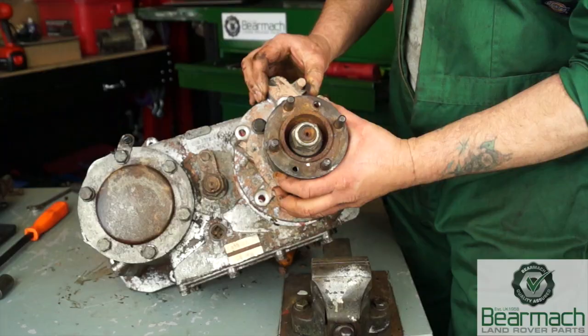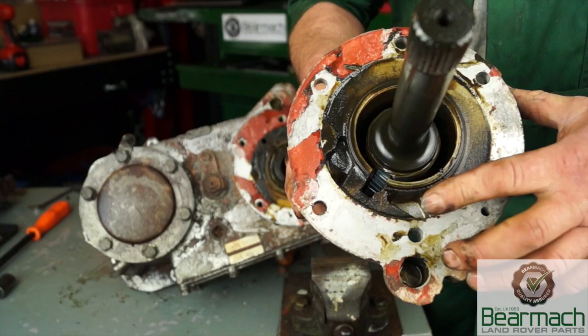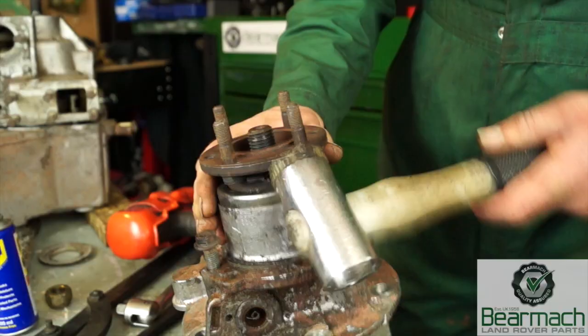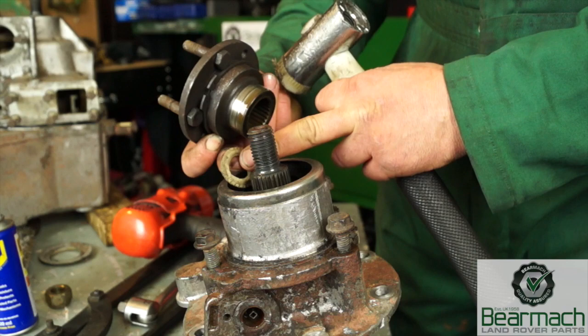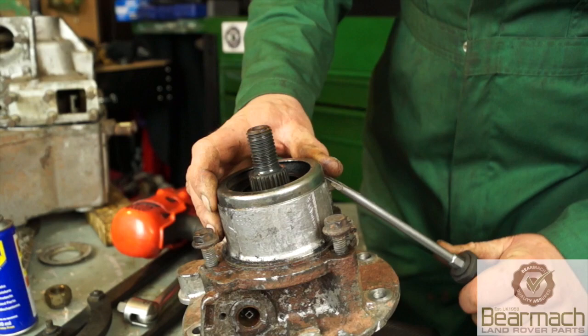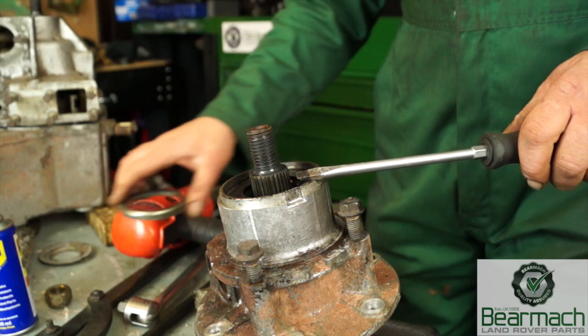We're also taking the rear cover off — that's easy — and what you'll find in here is the speedo drive, with the blue gear and then the gear on the shaft. Just undo the nut, remembering you have a felt washer, and check the seal land — if it's in bad condition then change the flange. With this one we also have a cap which we need to lift off with a screwdriver. Once you've got it in the slot and turned it, it'll lift so far and then you can lift it out. After that it's just a matter of removing the seal.